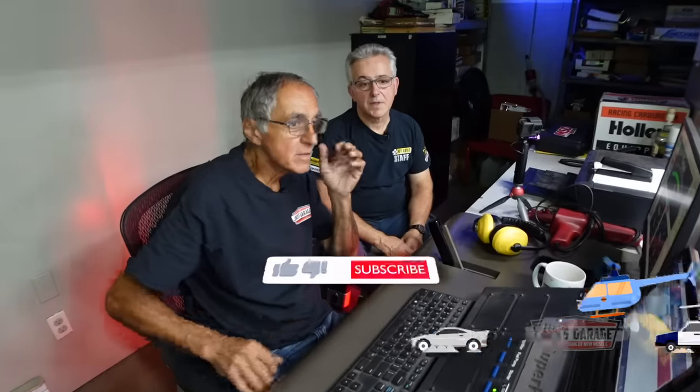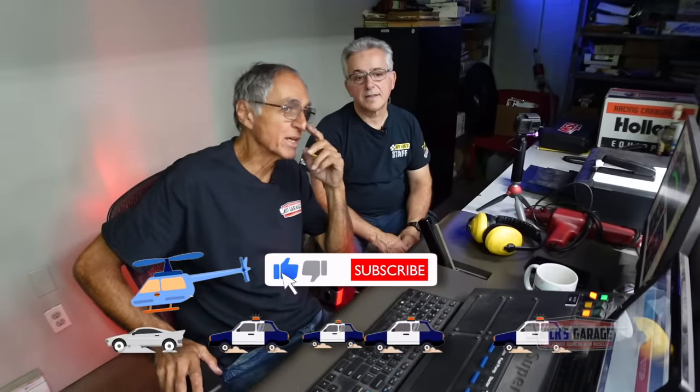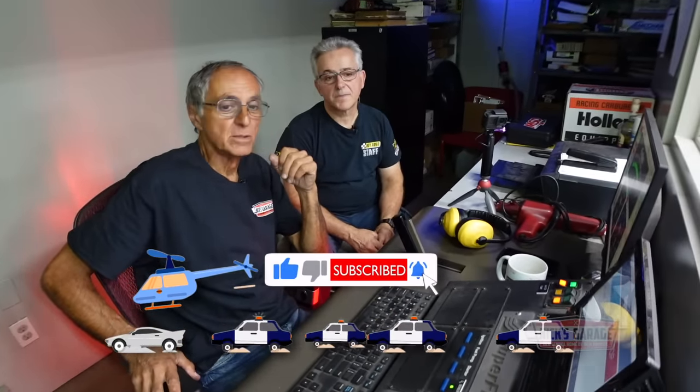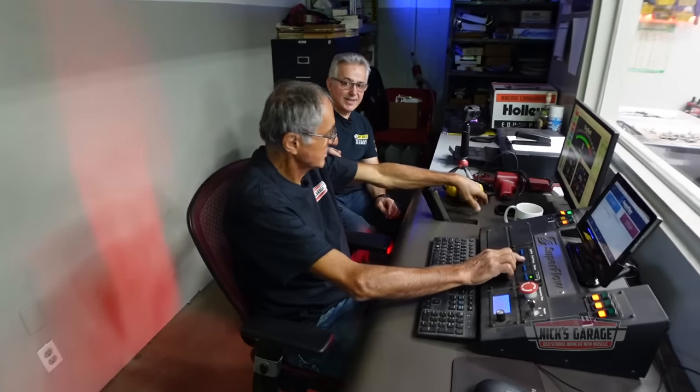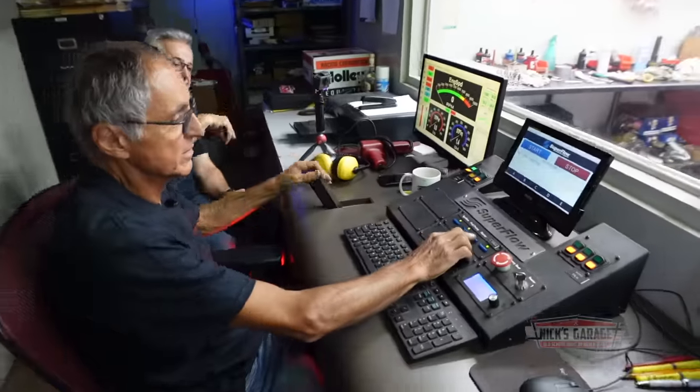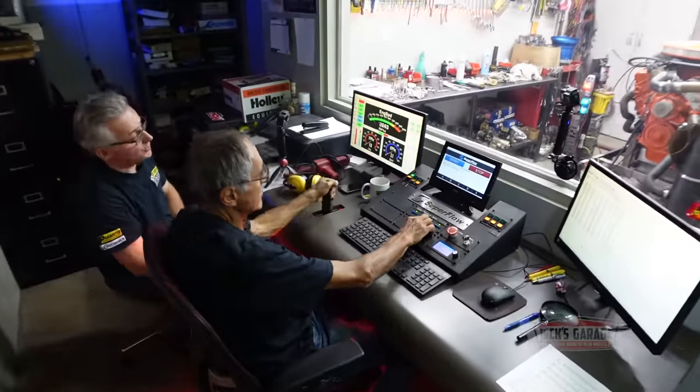So far, so good, eh? Look, you see the stumble, eh? I thought the stumble might be less with the air cleaner on. But the air fuel ratio is on the money, practically on the money with the air cleaner on. Which tells you something, because if you add the manifolds too. That's why we can't play with the carburetors. We can maximize horsepower, but adding on everything else, it'll bring the air fuel ratio into check.